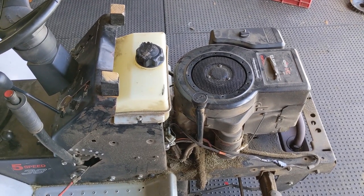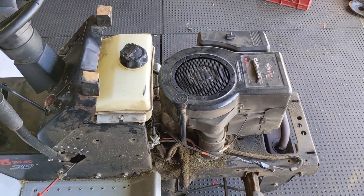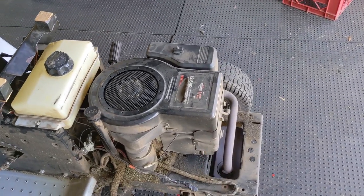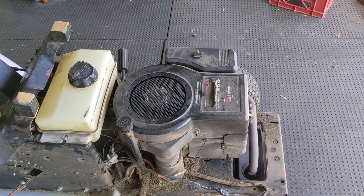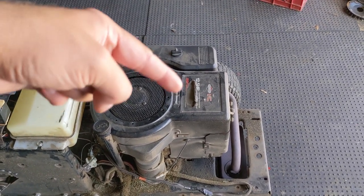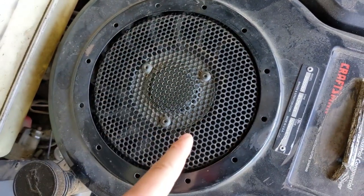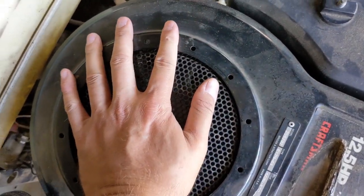So now you're getting a picture of what's going to happen. You go to turn your key — the key sends 12 volts to the electromagnet in the starter solenoid, making a connection between battery positive and your starter. The starter engages and begins to turn the flywheel, trying to push the piston up to top dead center. However, there's likely lots of fuel in that cylinder, and fluids cannot compress — basically making it impossible for the piston to go any higher. It essentially seizes the engine solid when rotating the flywheel clockwise, and this is commonly referred to as hydrolock. If you try to spin the flywheel clockwise it just doesn't spin, but spinning it the opposite way to pull the piston down, it rotates nice and freely.